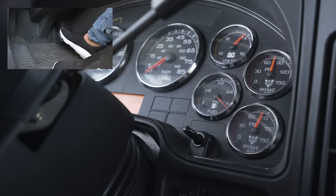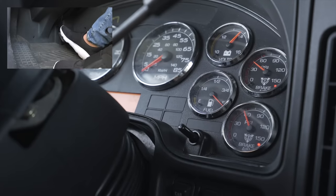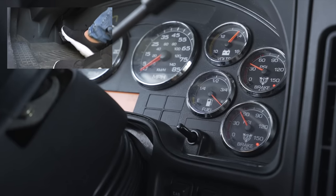Next up, we're going to check the alarms and buzzers. I'm going to fan my foot brake — my service brake — until around 60 to 40 PSI. An alarm and/or buzzer should come on to indicate that I have low air in my air tanks. My alarm and buzzer did come on — that works properly. Now we're going to move to the final step: the buttons. My emergency spring brake should come on while I'm fanning my brake to 20 to 40 PSI to indicate that those work also. My buttons both popped out around 20 to 40 PSI — that was a successful test.